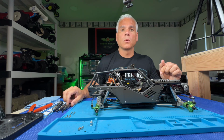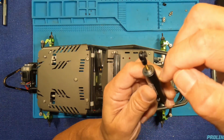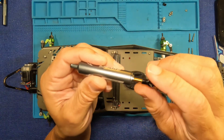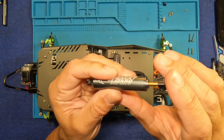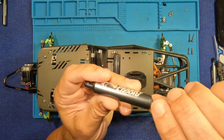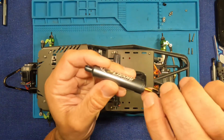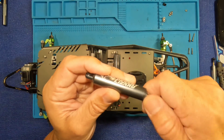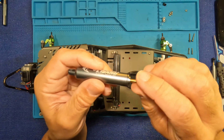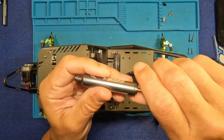A couple of things I wanna go over with you and show you, in case you do decide to get these, that I found. There's a little seal in here. When you put this cap on, it goes in internally. Obviously that seals everything. What you don't want to do is bleed it some, start screwing it down a little more, and then screw it down till that little O-ring touches the bottom and then bleed it some more and try to screw it down more, because it's going to push that O-ring out just enough. So when you go to crank down on this, it's going to pinch that O-ring out. You want to get all your bleeding done before that O-ring even gets close to the bottom of that seal. Then you leave a little gap, and then you go ahead and cinch it on down.